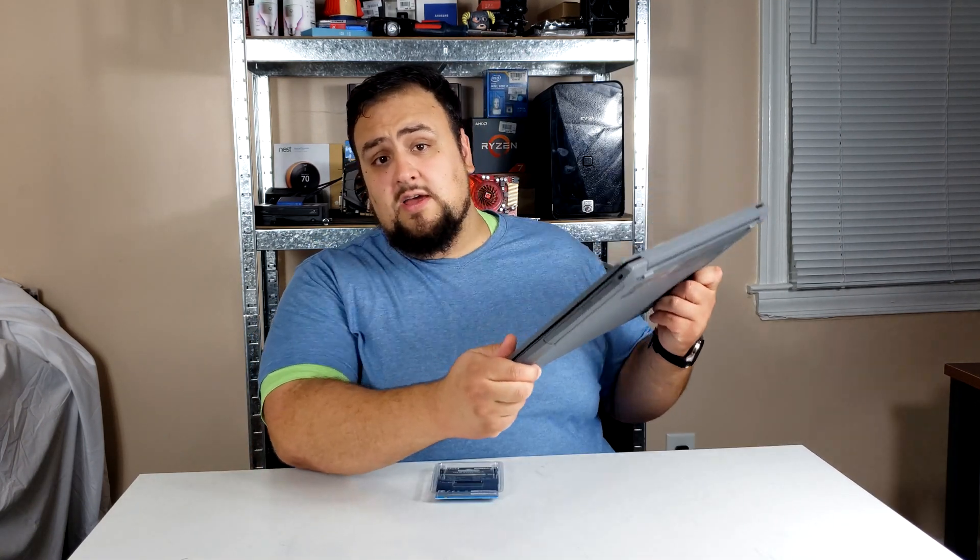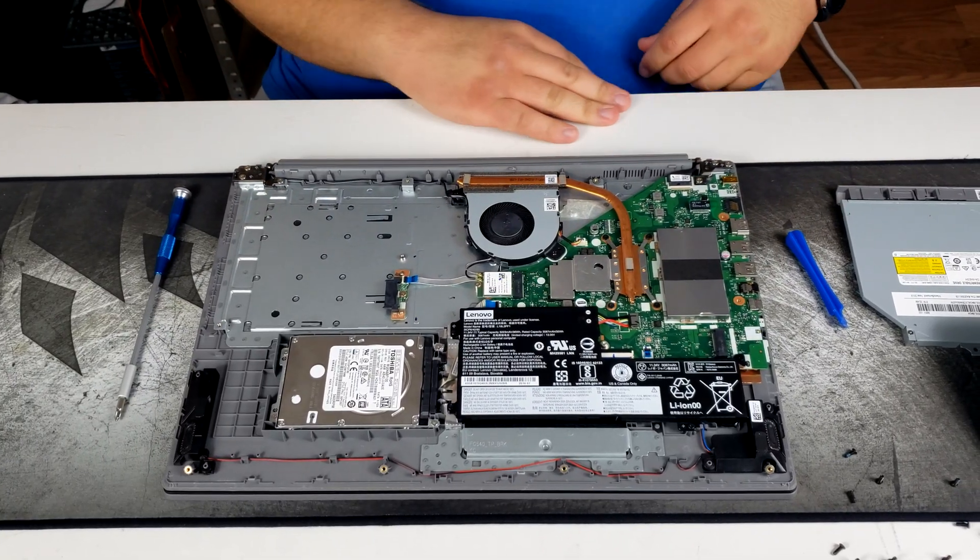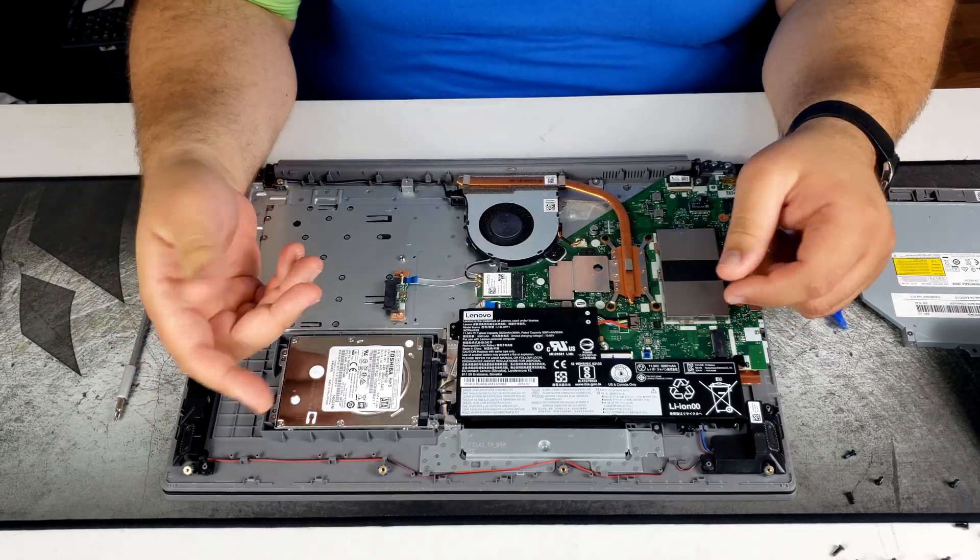You requested this video on the HP laptop, but I don't have that laptop anymore. However, my brother's laptop supports an NVMe drive and is currently using a small 2.5-inch mechanical drive. The plan is to install the NVMe drive for the OS and major applications, and use the existing mechanical drive purely as storage. The steps are fairly similar: remove the back panel, locate the NVMe slot, and pop it in.